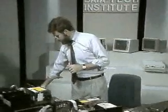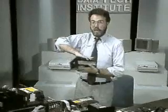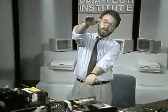When you're not using the drives or are moving the drives, don't close the drive doors. Leave them open. You see, there are two drive heads. One to read and write the top of a floppy and one to read and write the bottom of a floppy. They're like this when the door's open. If you close the door with no floppy in the drive, the two heads bash against each other. You can damage both heads that way.